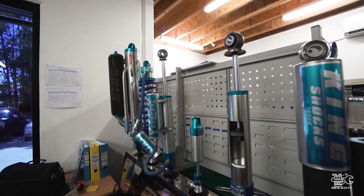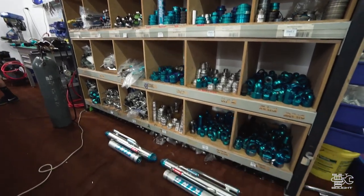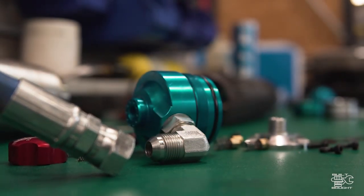These aren't really big in street cars at the moment - is this the future of suspension for tourers? Companies like ARB and Fox are already doing things with different designs - more of a twin tube design where the tube has holes drilled and allows oil to blend around the inner tube. King's is the only mono tube IBP I know of - there might be some motorcycle brands with a similar design, but King's the only mono tube IBP and they definitely work really, really well.